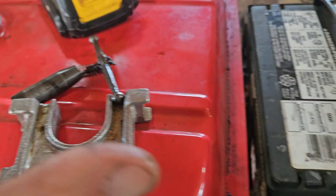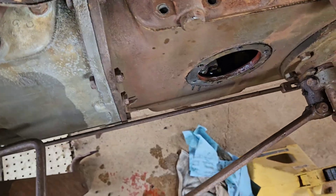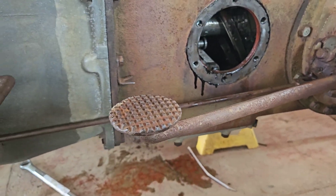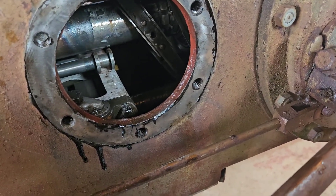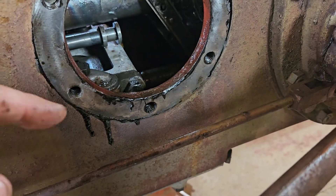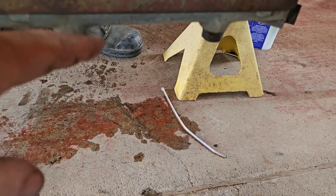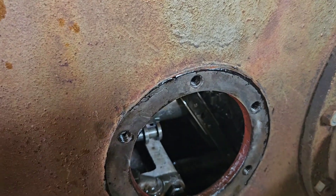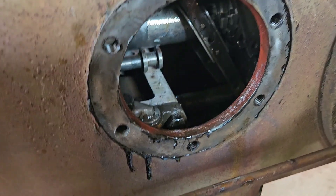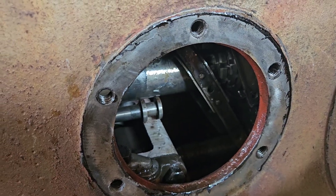All this stuff is kind of the jankiest thing I've ever worked on. I know people will say I'm only saying that because I messed it up — well, maybe so. But if you look at the Massey Ferguson / Massey Harris versions when they took over in the United States, it's a whole different design — not even close to this. The pump is basically the same and that's as far as it goes. The pump comes out through the top on theirs; this one comes out through the bottom. You can also get hydraulic power off one of these if you want — you just need to add the selector valve that selects between the three-point and hydraulic flow to a rear remote.